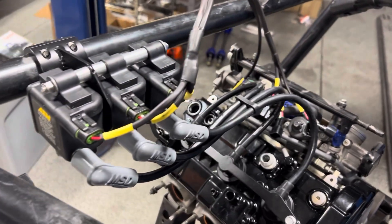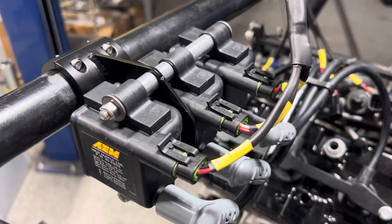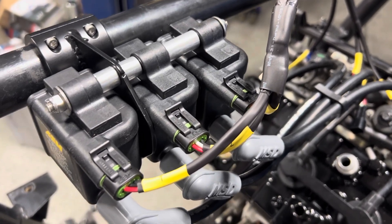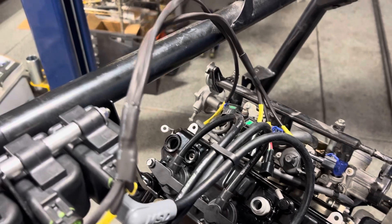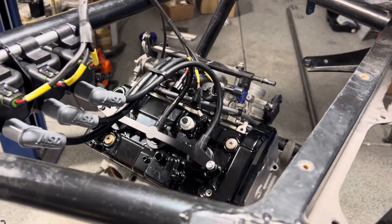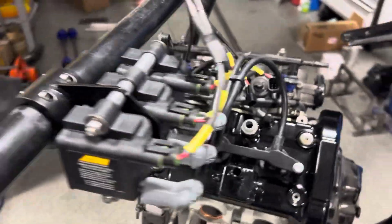This is all the parts in one box. You can bolt this kit on in about half an hour — pretty straightforward. Just install the bracket on your frame, install the spacers and long bolts that hold it together, put the plug wires on, route the harness, plug it in, and you're done. Easy fix for high power, big boost — either gasoline or E85, but really I'd typically always think E85 or methanol when you need a lot of spark energy.